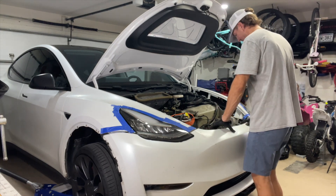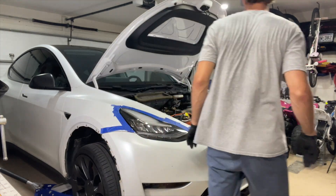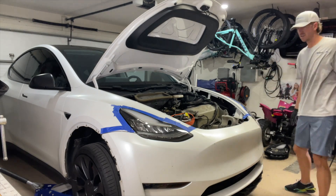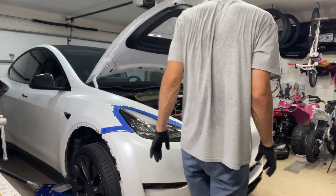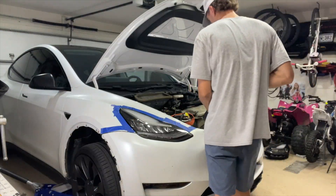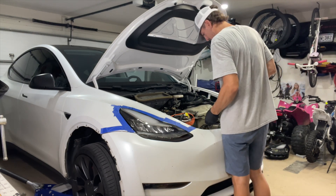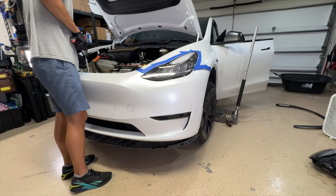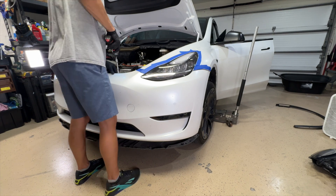From this point I'm going to push the bumper on. If you remember the part I struggled with, I'm just using a little extra force to slide it on there — no need to Hawk Tui on it or anything like that, she should just slide right on there. So now I'm walking around checking all my fender gaps, making sure they're good. Now I'm going to go ahead and tighten up the five bolts that go in the front that hold the fascia on, pushing with my knee to line the bumper up to where it was previously so that everything stays the same. You can tell by where the washer imprint is in the plastic.